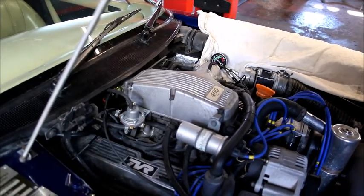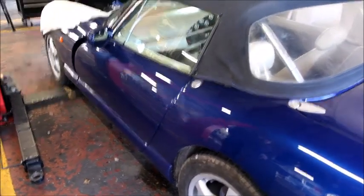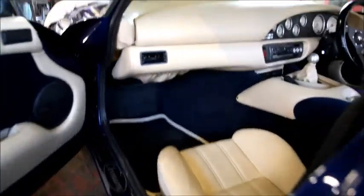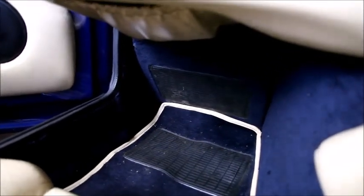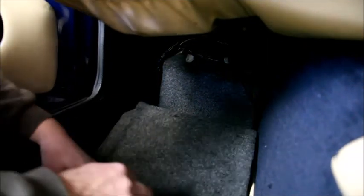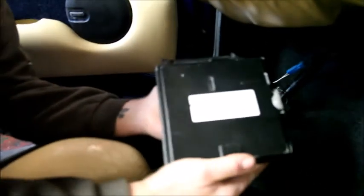We'll show you how we install those and then the car driving at the end. With the TVRs, the ECU is located in the passenger footwell — it's going to be a little bit difficult to show us actually taking it out because there's not enough room for two of us. The ECU is located to the left of the battery — just slide it out. The ignition is off so it's safe to unplug, and there we are: the 14CUX hotwire ECU, which we'll take into the office and show you being chipped.